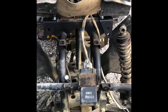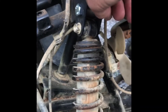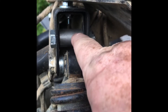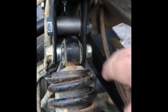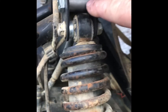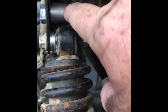The next step in the instructions after you drop the top bolt in and get the nut started on the bottom — but leave it loose — is to put this little spacer in place. I had to put a bar in here and spread it just ever so slightly to get the spacer in, and then you put the replacement bolt through the hole with the spacer to keep it from crushing.